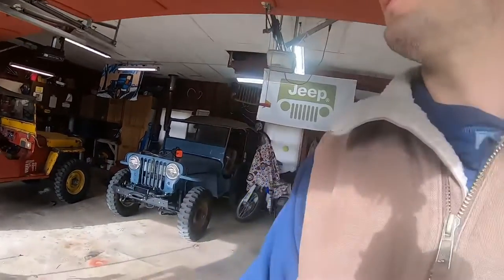Today's going to be a fun day. Good morning. My dad's coming over with his '47 2A and we're going to pull it in the shop and do a brake upgrade on it. His Jeep is completely stock, and we're going to add some disc brakes to the front axle. I'm going to use some Dana 30 parts I have laying around, and then we're going to do some brake testing. We're going to test his Jeep before we start working on it — nine inch drums all around, stock master cylinder, stock everything. Then we'll test it again with just disc up front with the drum still in the back.